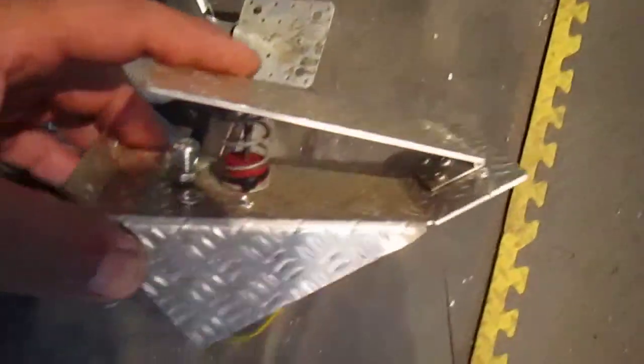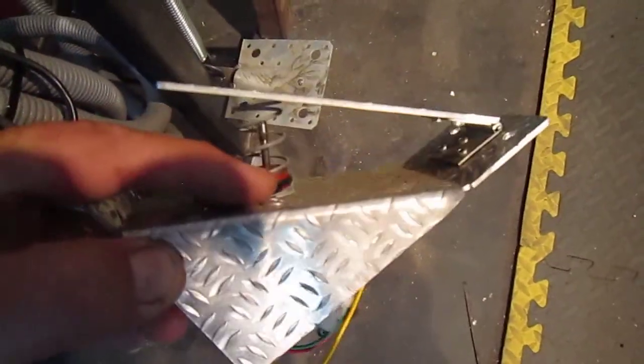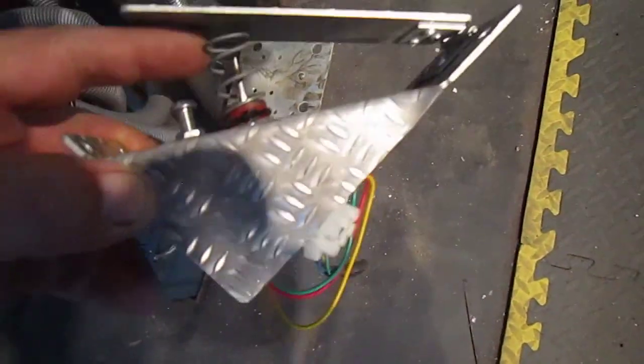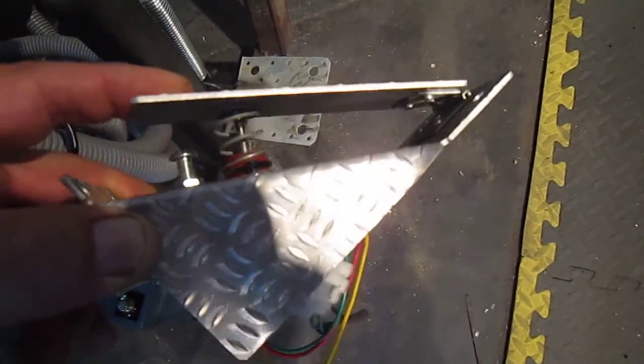This is the pedal from the Toylander — you can see it's a little bit flimsy, not very good. So what we'll do is take the guts of it out and build a new one with a much heavier spring on it, and then the controllability will be better. It's got a little breaker switch there which actually snapped, but never mind.